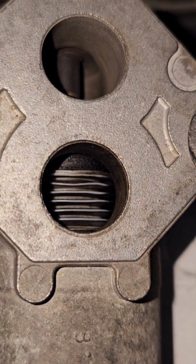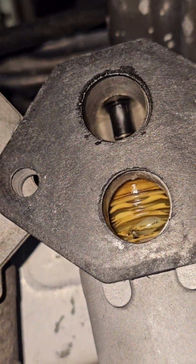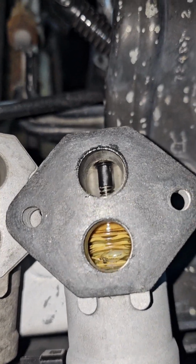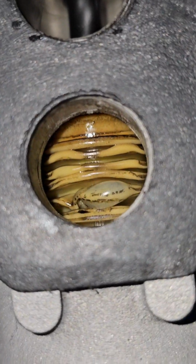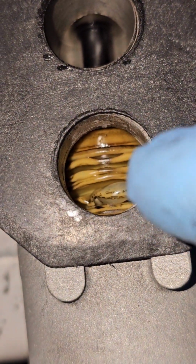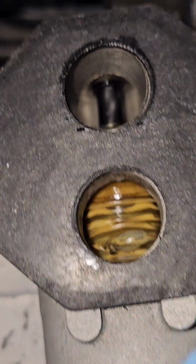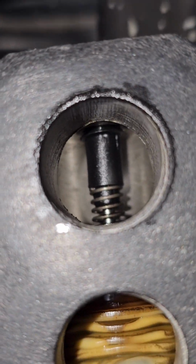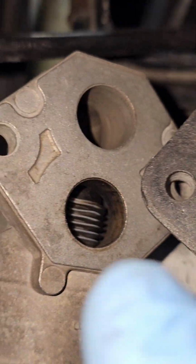This is the original Ford one. So, yeah, like I said, when I turned on the van, it started revving up really high, and I suspected that part right there may have been getting pushed up, or may have gotten pulled in, and got stuck, and it was allowing the air to go through more than what it should have been. Because you see that spring right there. This thing moves back and forth while the air is in.